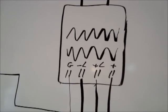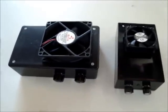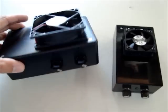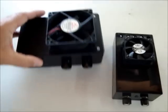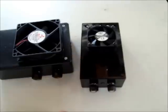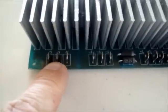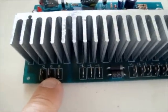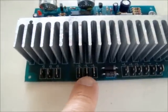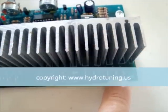Now, this way it's done and it's pretty easy. We have different PWMs — they come in a box or without a box. The 50 amps PWM is in this box, and the 30 amps PWM is in this box. When you open those boxes to connect the wires, you will see on the 50 amp PWM on this side: the ground — connect this to the battery — then connect the minus of the cell here, the plus of the cell here, and the plus of the battery from the car here.